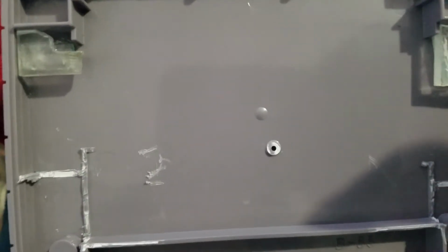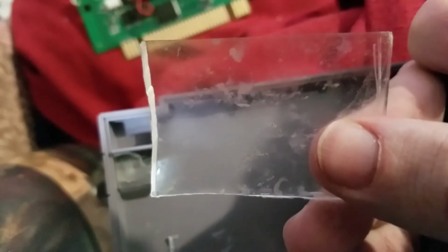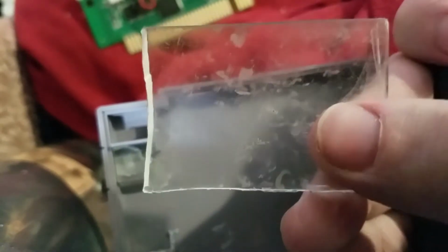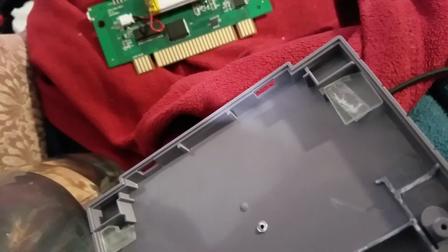It's pretty late now, and so I couldn't use my Dremel to do any of this. And my acrylic scoring tool, it's a lovely tool. It's so stupid simple, but works so well to cut straight edges. Like this edge here at the top, I think. Yeah, that straight edge. Maybe that one. I don't remember. I think that I cut that one. You just put something flat against the side so you have something to guide, and then you just drag the tool and score it like 1, 2, 3, at least 3 times I usually do, and then it'll just snap.